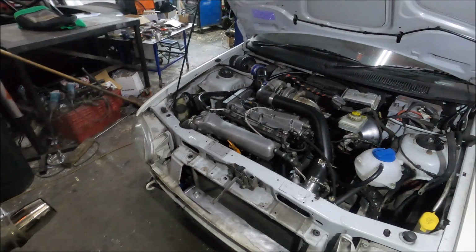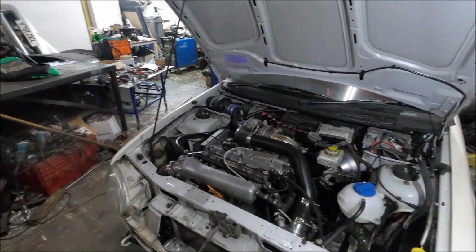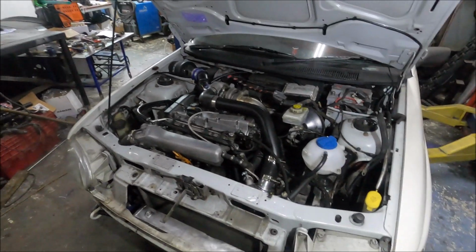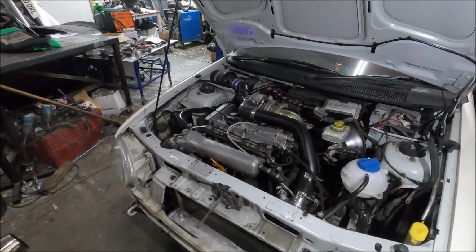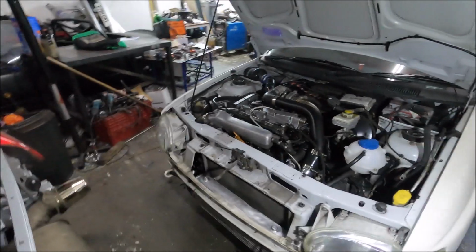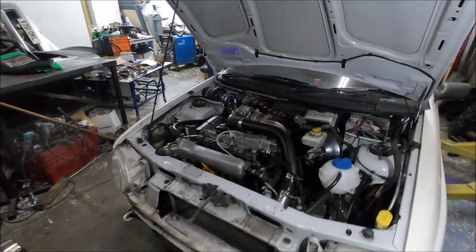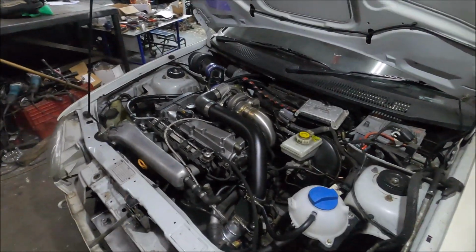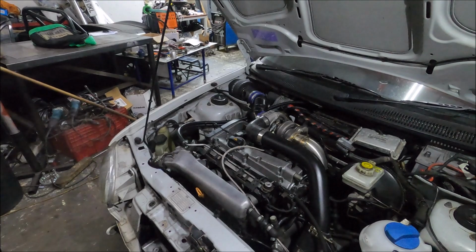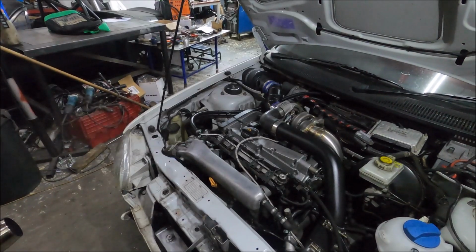It's right at home in this engine bay. You know, far more modern than the factory Ford engine. Now it's got drive-by-wire throttle, hydraulic clutch, you know, proper cable gear shift setup, 6-speed, 20-valve turbo, VVT. It's modern, but it fits really well. And obviously, no end of possibilities now tuning-wise with one of these under the bonnet. 3-inch exhaust, turbo back. It's got a sports cat as per the owner's wishes, just so it would MOT easier and stuff. But yeah, it's as cool as anything.